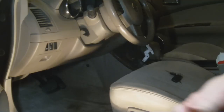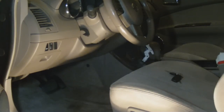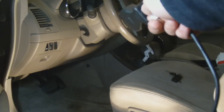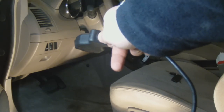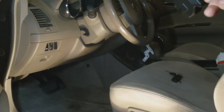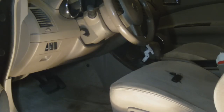To use these gizmos, there's a plug — it's like a triangular-type plug that plugs into your vehicle. It can be in a few different places. On most vehicles, including this one, it's under the steering wheel on the knee bolster. I've seen them under the hood and on the passenger side — specifically on a Saturn, they're on the passenger side on the right-hand side of the center console. Your owner's manual will tell you where it's at; if not, pick up a Chilton's or a Haynes and that'll tell you.